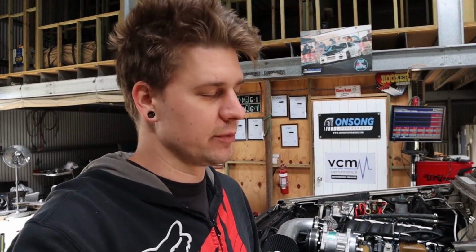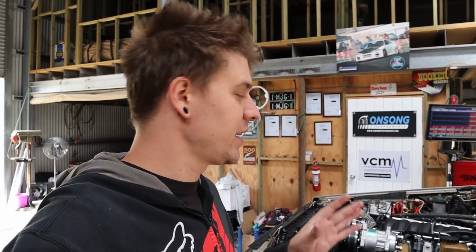So we came in this morning. I just wanted to double, triple check and confirm that we definitely can move the issue, as we were doing the other day. We can move it using the injector plugs. If I swap 6 and 8, the issue moves to 8. So it's definitely on the injector plug, the injector trigger, as we already thought. I just wanted to make sure we weren't imagining things when we were moving it between cylinders, just to confirm it wasn't anything mechanical. So based off the mechanical tests we've already done, the fact that it makes power, and that you can move it onto another cylinder, we're happy to completely rule out anything mechanical.